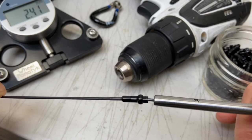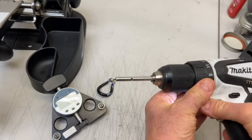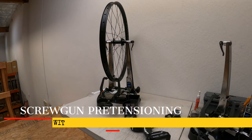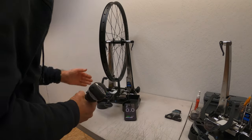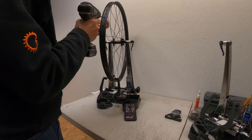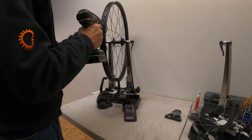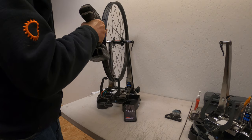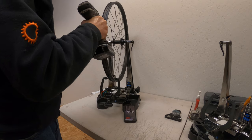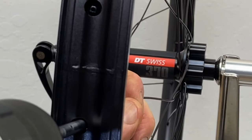So I'm putting my custom square drive nipple driver bit in a screw gun, and now I've got the just-laced totally loose wheel. I'm going to go around and time how long it takes to tighten the nipples with the driver — the screw gun. I think as you watch you'll see that the screw gun is easier than the spoke wrench. But how much faster do you think it'll be? I thought it would be at least twice as fast. Sometimes it's slow to get the tool seated on the nipple — you have to do that, or else you risk ruining the nipple or rounding the end if it's not seated correctly when you start spinning the drill.